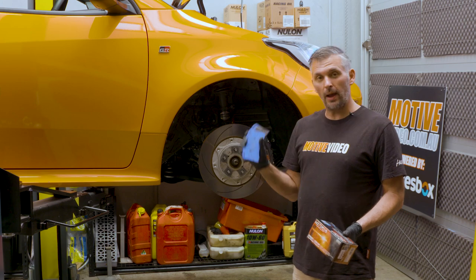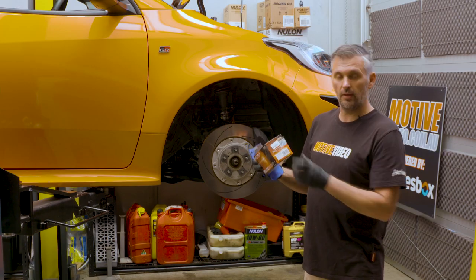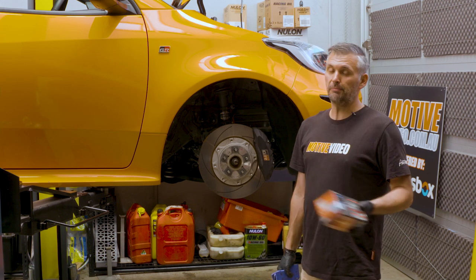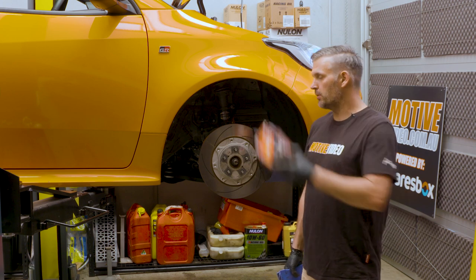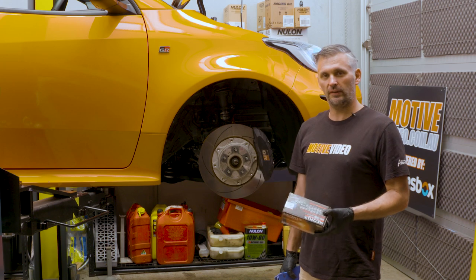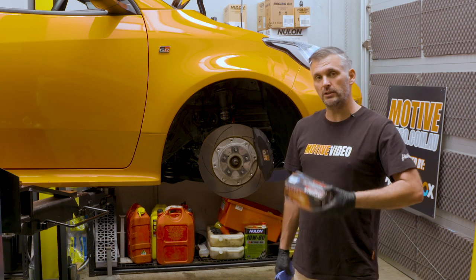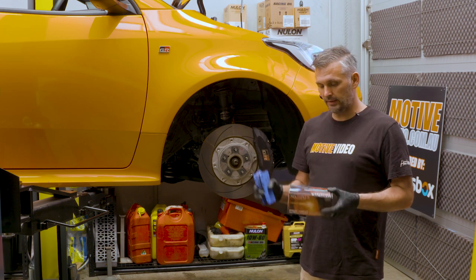With the braided lines in the car, the next step is all new pads. If you wonder why they look secondhand when you open the box, that's because the guys at V Sport bed the brakes in for you — they have a sticker that says 'already bedded.' They've been clamped, had dust come off them, so they look secondhand, but all the material is still there. Why buy pre-bedded brake pads? One, V Sport know what they're doing and bed the pads in correctly. Secondly, it can be a total pain to bed brakes in at the track. If we're going to challenge Bathurst and it's not a registered car, when are we going to bed the brakes in? We'd either have to do it illegally in an industrial area, or use our entire first session just trying to bed them in. I'm a big fan of pre-bedded brake pads for track cars — it just saves so much hassle. As a street car, you could bed them on the street, but you've got to do a bunch of hard stops from 80 km/h, which is dangerous. Pre-bedded brake pads — awesome idea from V Sport.